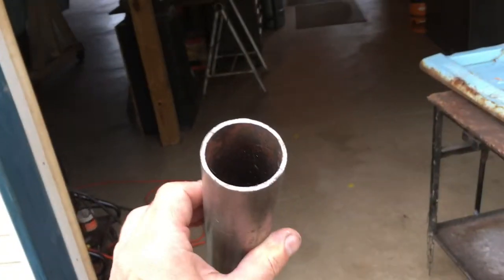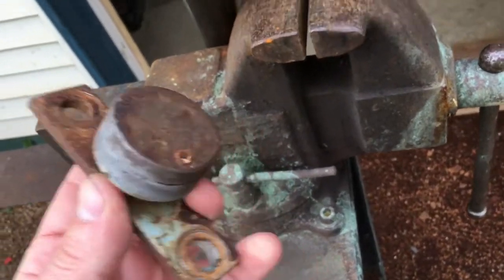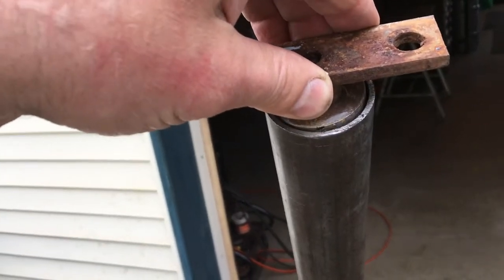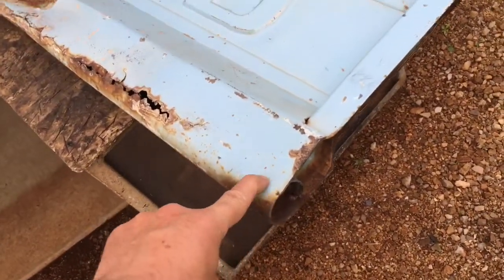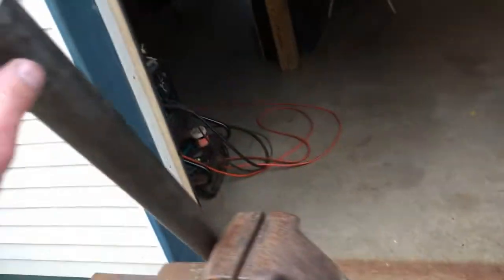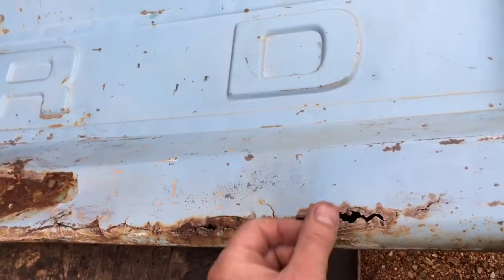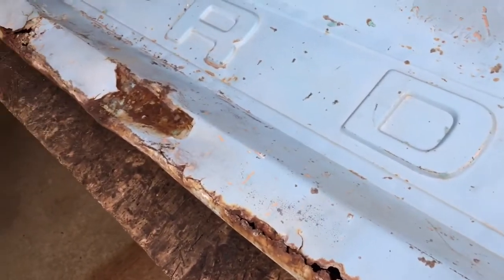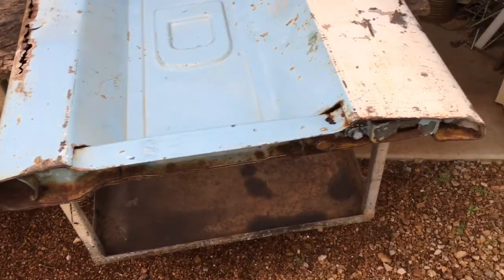I bought this drawn-over-mandrel tubing, it's two-inch OD, 95 thousandths wall, which makes it about 1.8 inches ID. These are like one and three-quarter, so they're gonna fit in there. The idea is I'll cut the whole bottom of this off. I think I need to weld washers in at the same depth for stops, just to set the side-to-side movement, then patch here and the bottom. The tailgate's got a little bow to it — straighten that out.